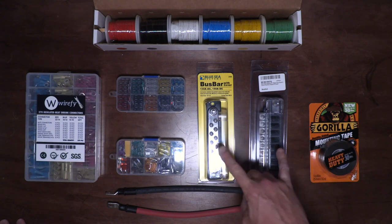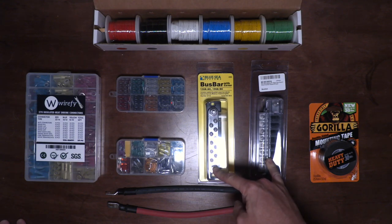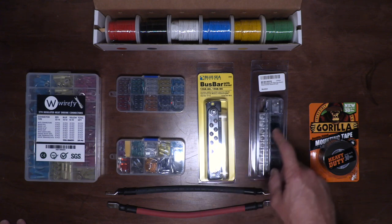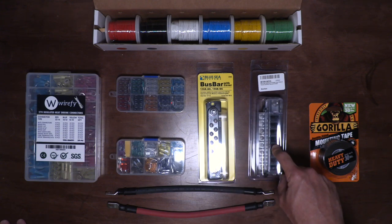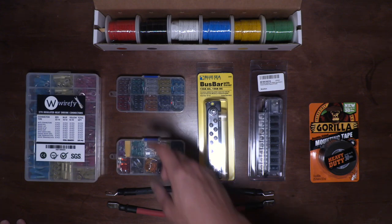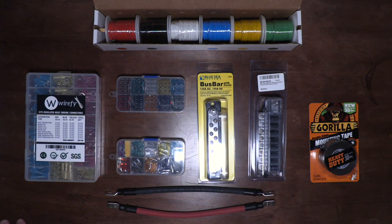This is what I'm going to use to attach these two guys to the inside of the seat. The weight with 18-gauge wire is not going to be that big a deal. This is going to come up my charge relay and the auxiliary battery and go to the positive bus bar, which is for the fuses, and then go to the 12-volt pieces. Then this is going to go to the ground in the middle of the seat, so all my negatives can come here and terminate and ground off into the van. I got a bunch of different colors so I can color code what I create.